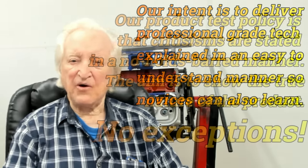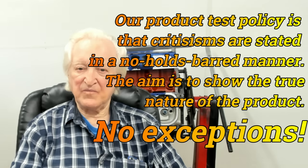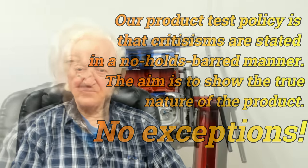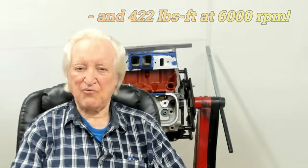Now essentially, although you can copy them for street work, these are a pair of my vintage category race heads. They work very well if you follow what's on there. On a two-plane manifold with about 12 to 1 compression on pump gas — that's 91 octane — and stock rockers, flat tappet cam, quite a few other things. We managed to make 503 horsepower at about 7700 and put the gear shift point at probably about 8.